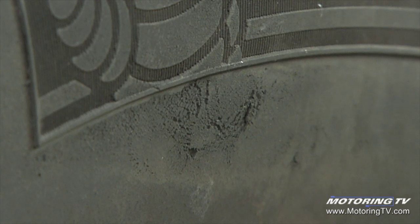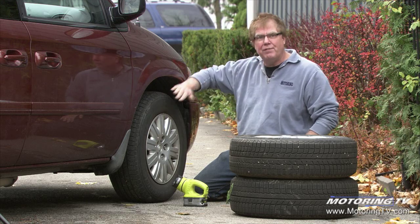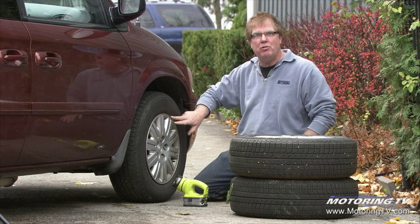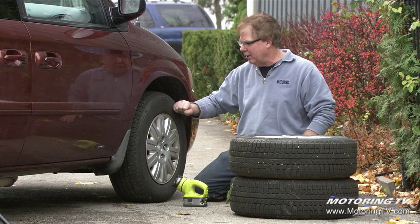The tire may not actually blow or rupture, but you'll oftentimes find a wave or a bulge in the side of the tire that corresponds with that abrasion mark you just put on it from hammering it into that obstacle, whatever it is.